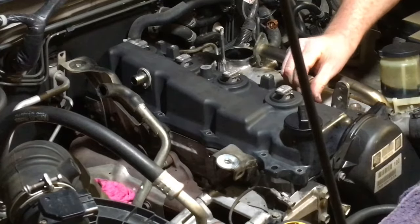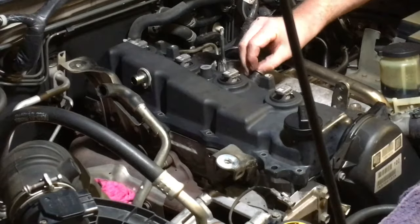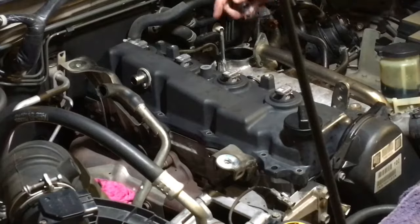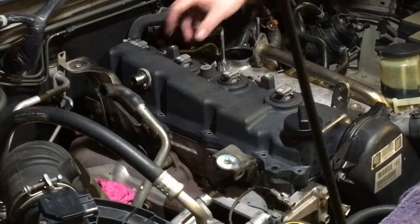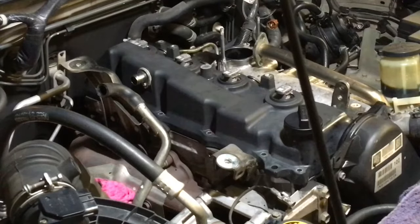Right, so if there's anything in the air, it's not gonna fall down into those nozzles, right? Which, they're not quite clear with just the cover there, right? So that's the first thing I wanna do. If there's anything falling down, it's not gonna fall into those injector inlets now. But they're still open, okay? What we'll do now is we'll chuck the bolts back in, the nuts and bolts and everything.